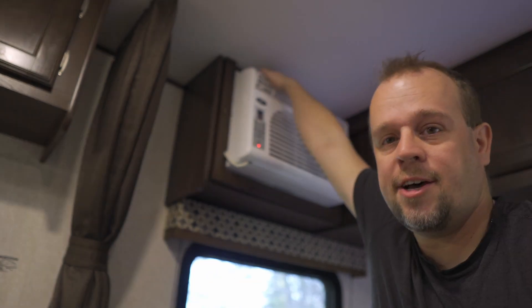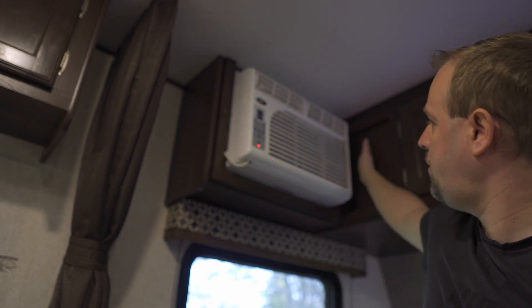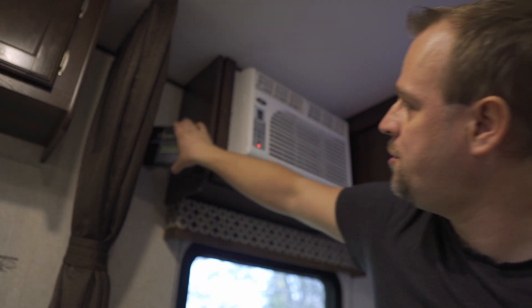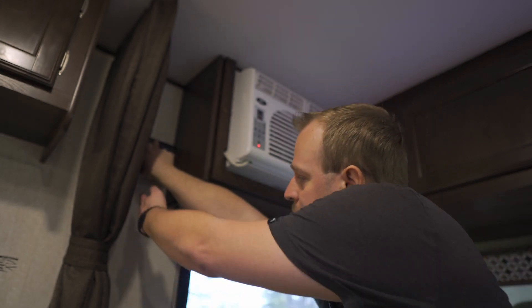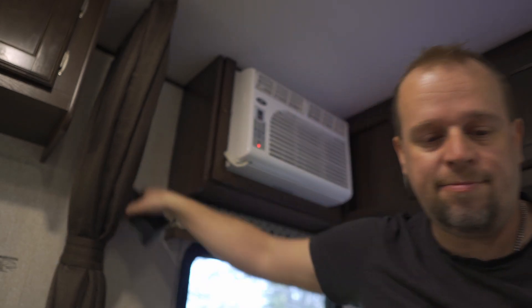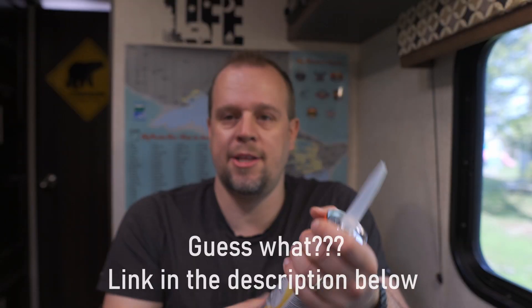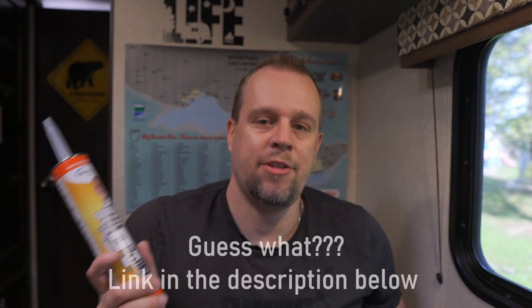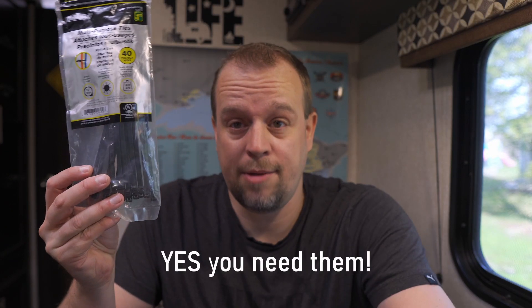From an installation perspective, I'm hoping to run the cables through the fridge roof vent — I'll need to undo the screws on all three sides. I'll likely mount the controller here so I can fish the wires through, then run them straight down. From a tools perspective, you'll need lap sealant — I bought a four-pack. Even though the bolts that come with the solar panel have washers, don't trust it — get some lap sealant. Also grab some zip ties and electrical tape.